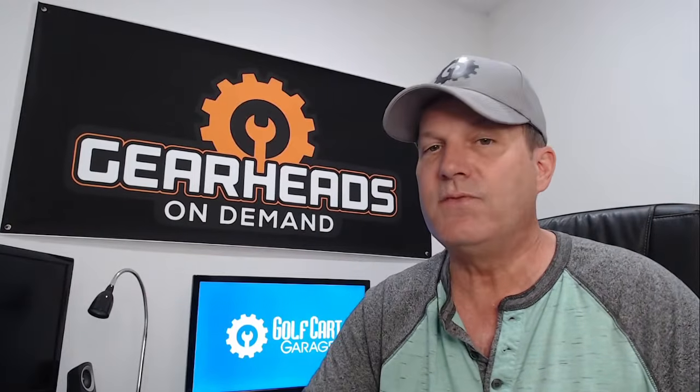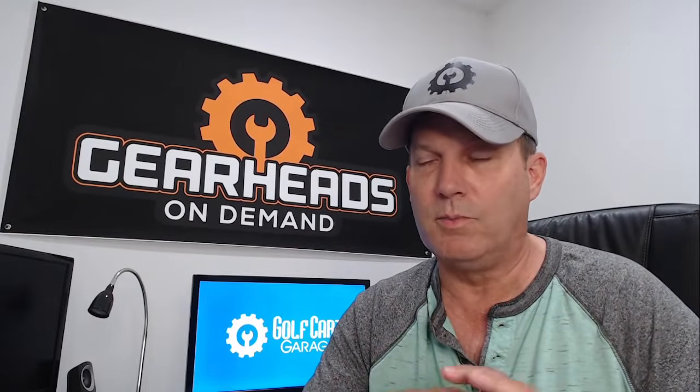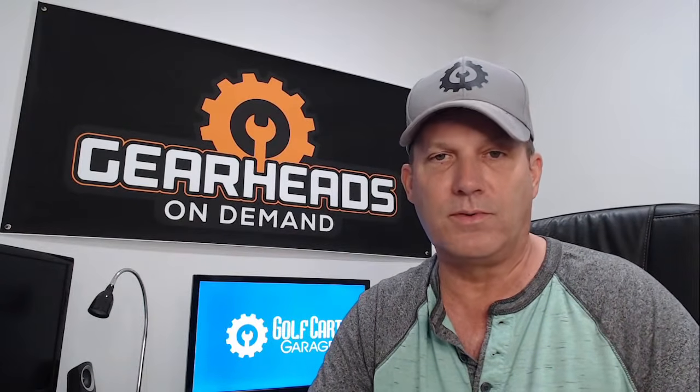I'd like for you to do each battery individually and see if you find one of those that's responsible for the biggest part of that voltage drop. And that may be your culprit right there. You might have a battery that's dropping down way more than the other 5, or if you got 4 batteries, than the other 3.